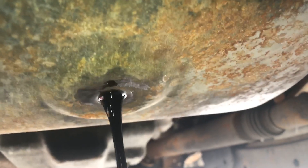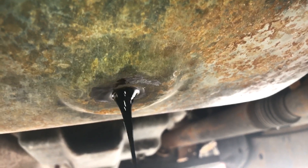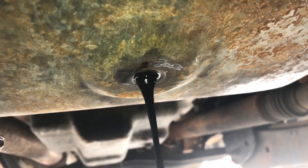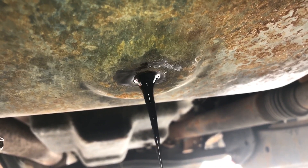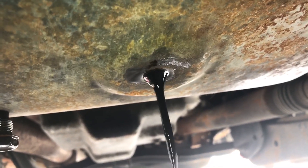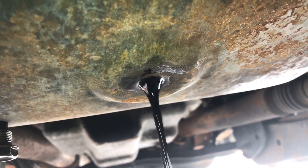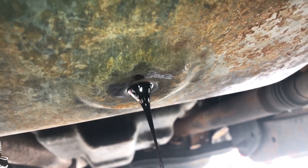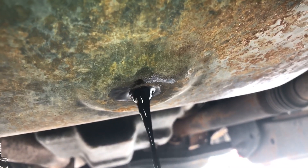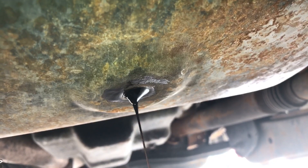It's not good. Let me hold it up so you can actually see. Look at that — yeah, that's not good. The IPR is maxing out, I wonder why — it probably has no oil. Normally it would have a little bit of milky color to it if it was coolant mixed. I think Julie said we just changed the oil 2,000 miles ago, back in February. Look at that — something happened.